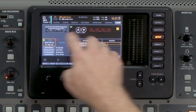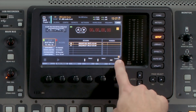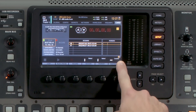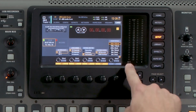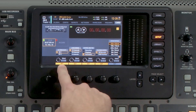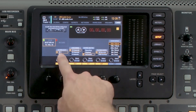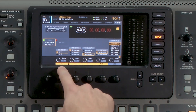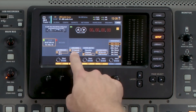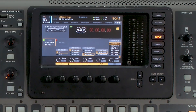You'll notice that we can see our X Live card, and I have a couple sessions here that are already recorded. We'll notice that there's a second page on this, so go ahead and go down to your second layer — there are a few things we need to set here. We can select between our two SD card slots. I only have one SD card in this right now, so we can see it's selected on SD card 1. Our SD recording is set to 32 channels, which is what I want — all 32 channels being recorded to the card. Channel routing is our next selection.